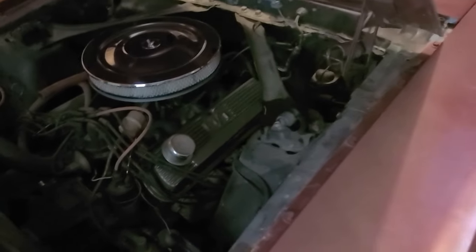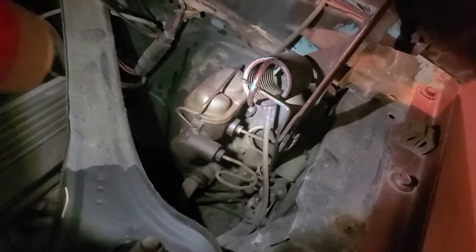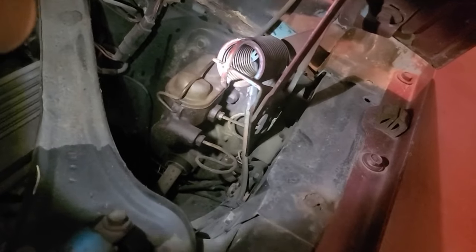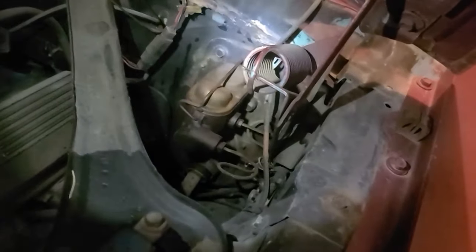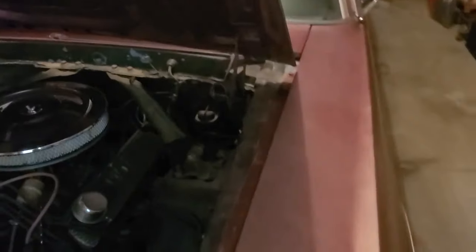Well, I just realized something. Maybe some of you picked it up when I was recording, but that master cylinder, that bar that holds the top cap of it, was off. So I've been driving around with that cap off. It's been leaking, if you can see down the side. And I was wondering why I was losing brake pressure on the pedal. And that seemed to be the reason.